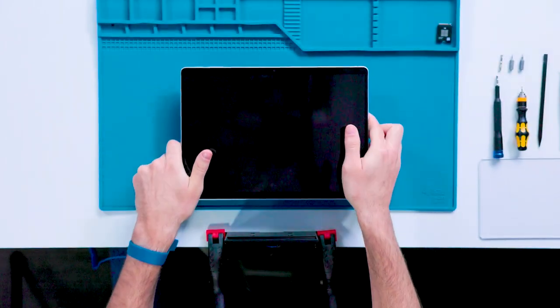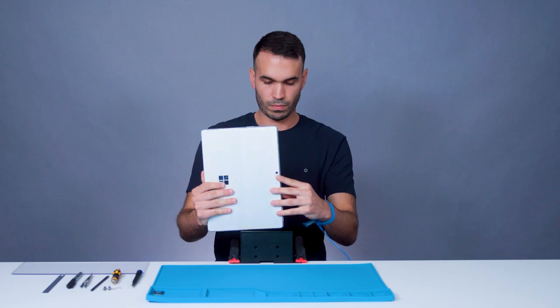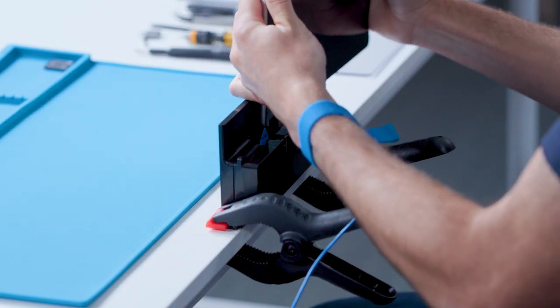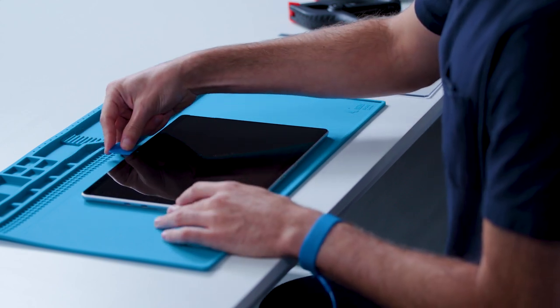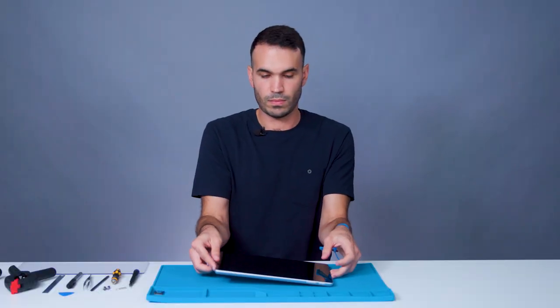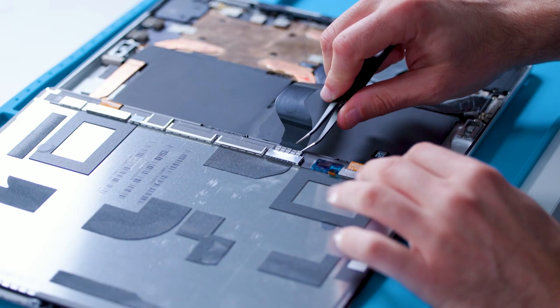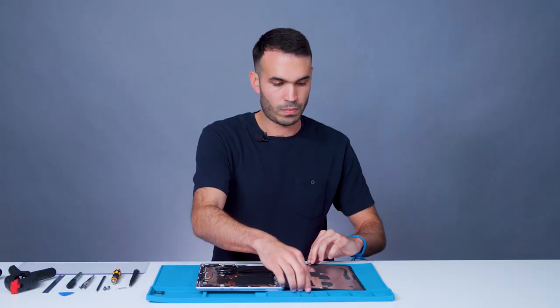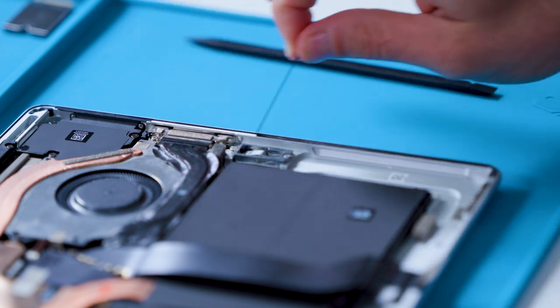After a full cycle, we'll remove the device and adjust the opening pick to 8mm to cut the top edge adhesive. We will only use this depth on the top edge of the display. We will then set the device flat and carefully lift the display away from the enclosure. If needed, you can use the opening pick to help separate the display. Flip the display 180 degrees so we can disconnect it from the device. We will reveal the connection by removing a shield lid with plastic tweezers and using a plastic spudger to disconnect the cable from the display. The adhesive can easily be removed by manually peeling it away from the enclosure and the display.